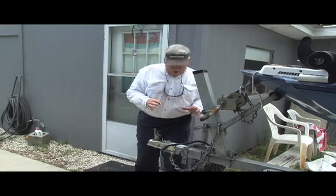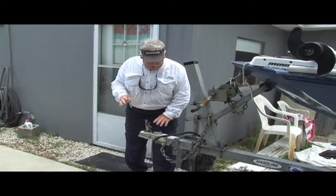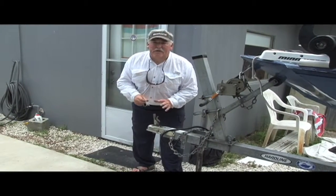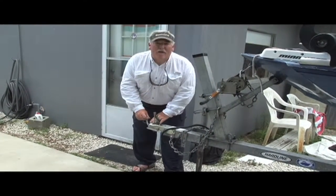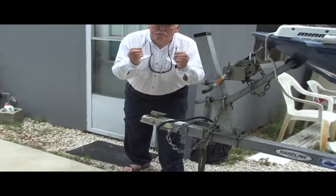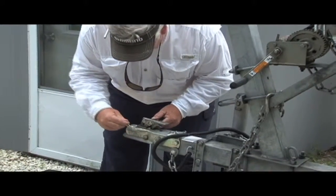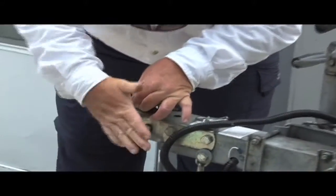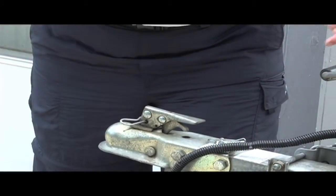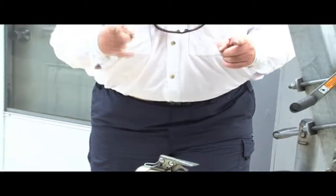Not only when you mount your trailer onto your trailer hitch and you're ready to go, but there's something you really need to think about. That is locking it down securely. After you've got it on the ball and you lock this down, use your pins friends. Make sure and slide this into the lock like it's supposed to be, and now you can relax and you don't have to worry about losing your boat. After all, we want to get to the river safely and have some fun.